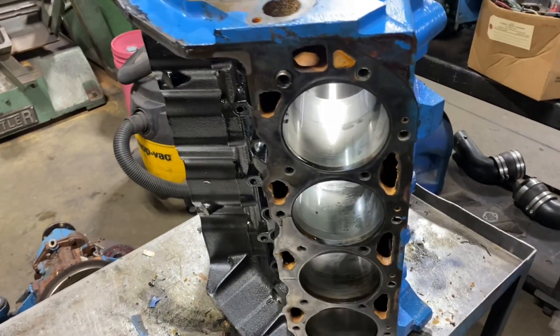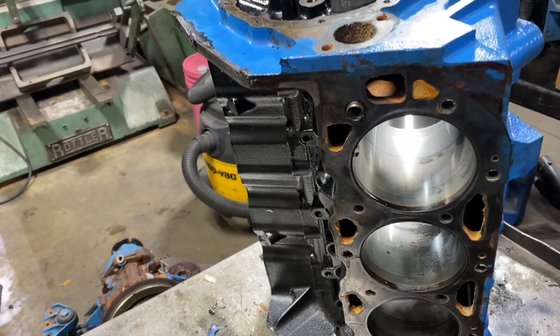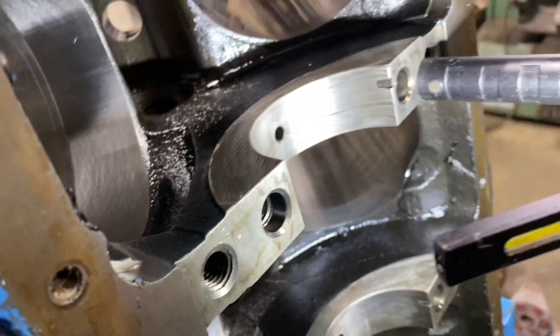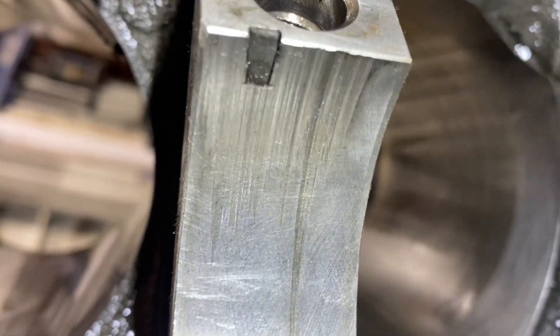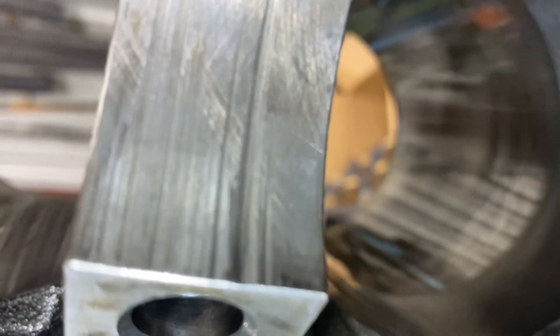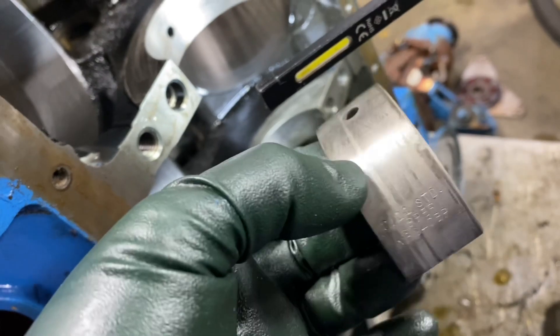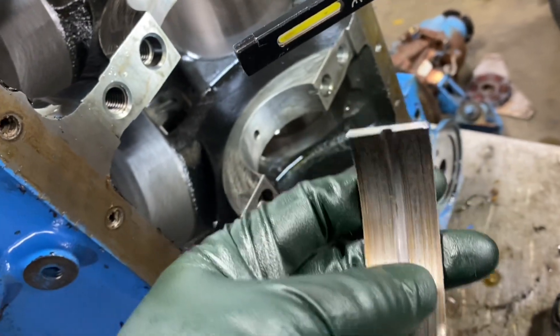This 454 Gen 5, probably '92 to '95 vintage, has really had a hard life. Look at the grooves in the number two main journal — somebody line honed right over it. You can see where it's never been touching. Here's the bearing I took out of it and you can see that little white mark where it's not been contacted — so that bearing has had a bunch of stuff go through it.